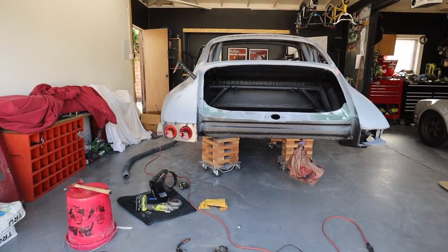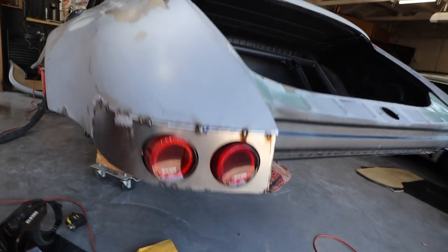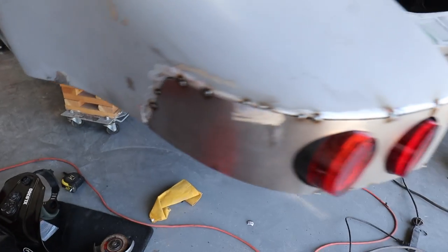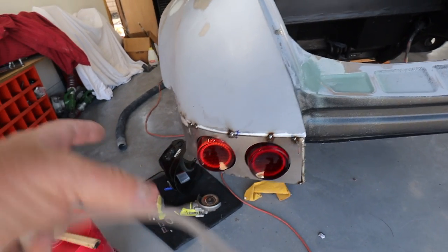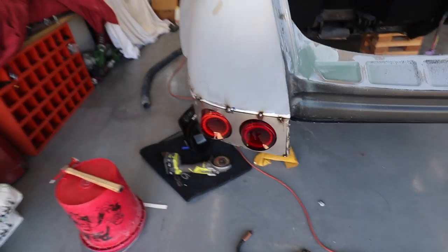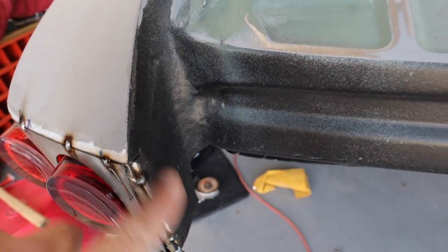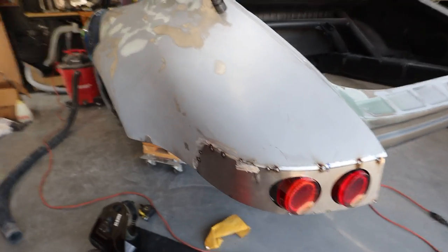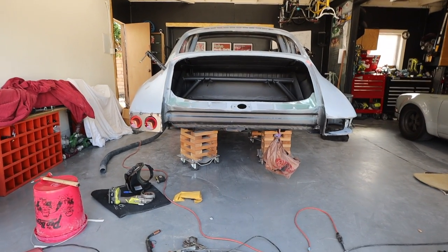I've got it on — this is the most fitted I've ever had one of these. It's still very loosely tacked and I can cut it off in a couple minutes if I need to. The big test is to see if I can pull the light frame out from the inside so I can then do it on the outside. I'm pretty happy with the stick out — it's got just the right amount, nice and low-key. It'll have to be bodyworked and I'll fill it all in with weld, but let's see if we can get the inner frame out because if I can, then I can do the other one. If they both look equal, we can weld it up.